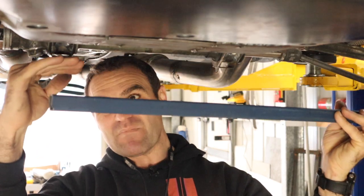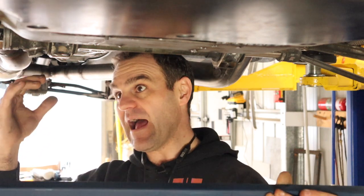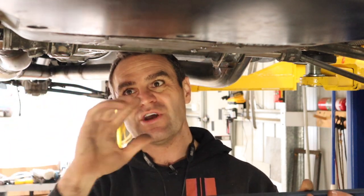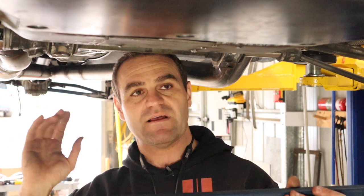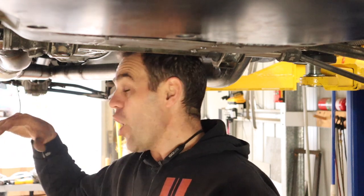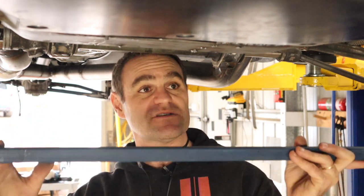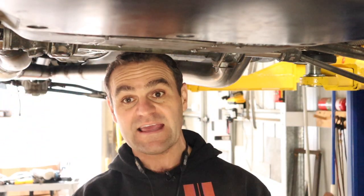I think that's the best way to cover this stuff up without making the car too much lower at the front. It's already got a little bit less ground clearance with the exhaust, which does sit lower than this front centre brace, but I'm not super worried about it. I've checked and there's over 100 millimetres — about four inches — underneath the car before anything hits at a comfortable ride height. So there is plenty of clearance. Let's chop out a piece of this square tubing and get ready to weld it in.